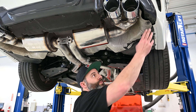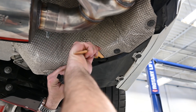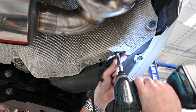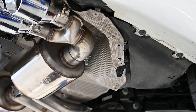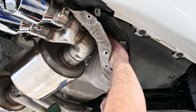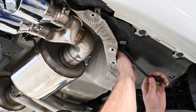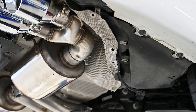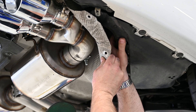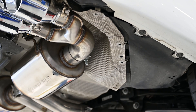We'll remove these three bolts and pop this wiring harness out of the heat shield. With the bolts removed, we can gently pull the heat shield forward and thread the wiring harness up and through the opening. Reach up and around, grab it and thread it back down. This will allow us to plug the valve motor simulator into the plug and then put everything back up into this pocket. With everything neatly tucked away, we can reassemble the three bolts.